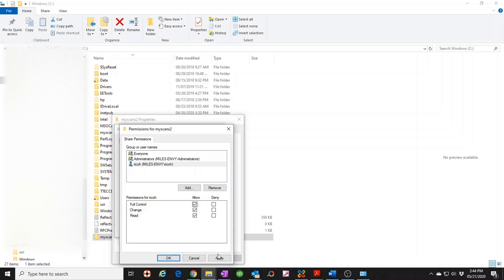Once logged in, put your cursor over Device Management and select Address Book. Wait a few seconds for it to load. I already have two entries set up, but I'll walk you through adding a new one — if you've never done this, it'll likely be blank. Click to add a new user. Select 'folder destination' since we're doing a scan to a shared folder and put a checkmark there. Note: most RICOH copiers show this section cut off in half due to browser compatibility. Just put your cursor under the black line and scroll down to open it up.